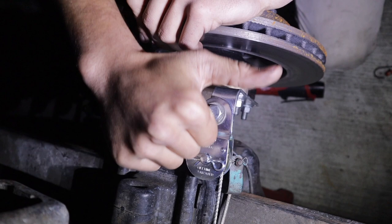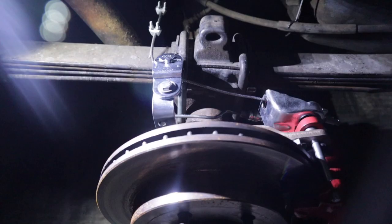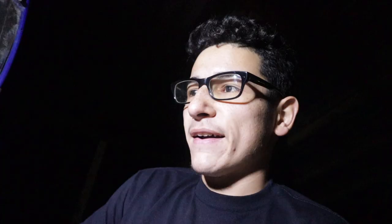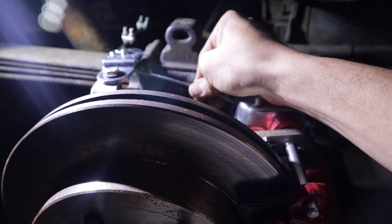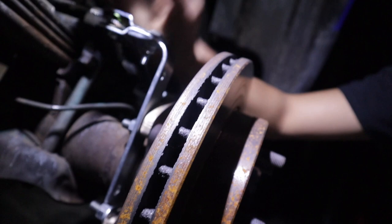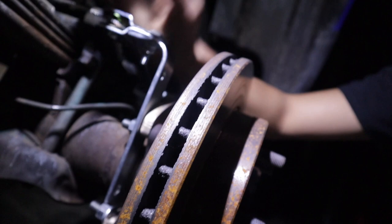We're good - we got e-brake! And just like that we have a functioning e-brake system. Make sure the line is tight before you put the U-clamp things on. Put two of them just to be safe and make sure it holds tight. Very happy with the outcome - this thing works perfectly. I showed you guys when I pulled it, it stretched out, rolls on this, and when I let it go it comes right back out. It's perfect. The only thing I didn't like is I wasn't able to put the bottom hole on, but this thing is solid - it's not going nowhere. I know the e-brake is working so I'm going to put the wheels back on, try it, and if it works we did one hell of a job.